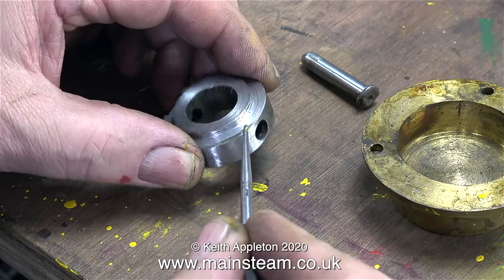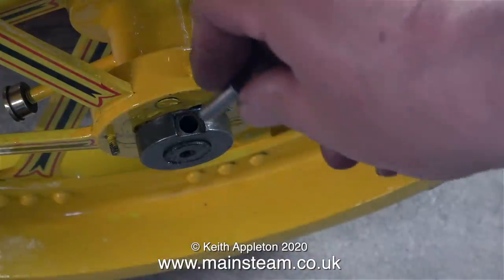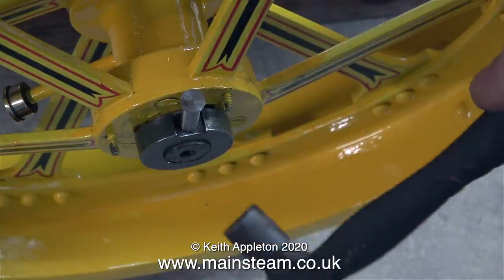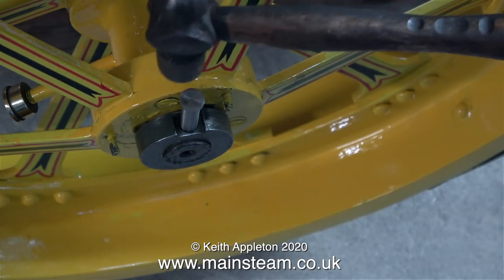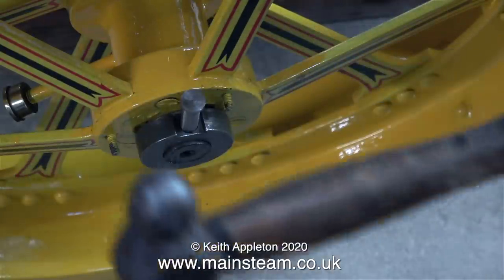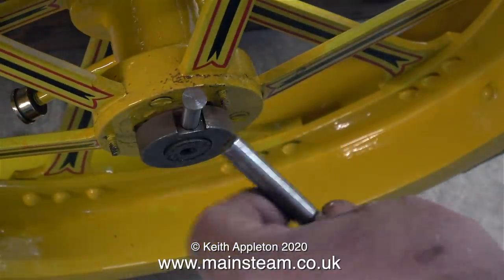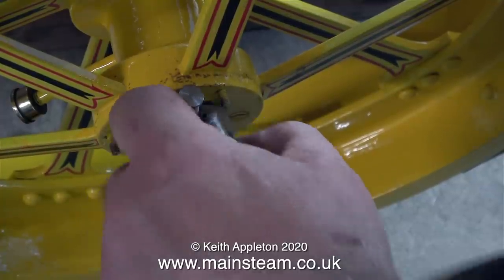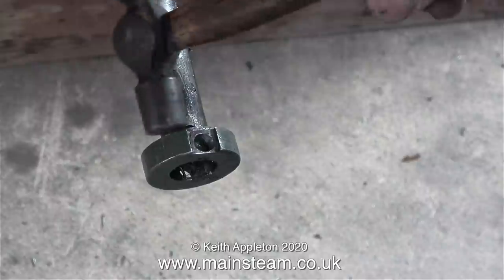Time to look a little bit more closely. The collar has also received some ultraviolence — look at the marks on it. The slot in the collar is supposed to be at the top and the pin just presses through the hole with your finger; you don't need to use a hammer. I'm only tapping it to see if it's in the right place, but when I tap the pin it's really solid. Originally this was mounted upside down and I had to tap it out of the hole, which took some doing. Now I'm using a piece of steel to tap this pin upwards. Having removed the left hand side wheel there was no problem at all, but not so on this side — even the collar appears to be quite a tight fit on the axle.